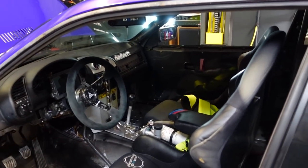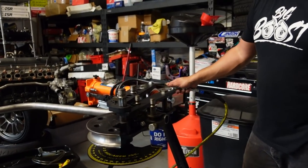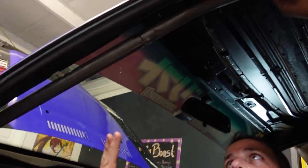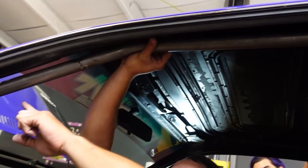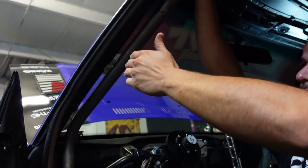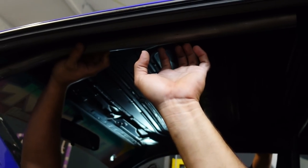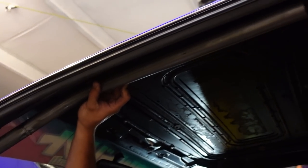Now for the next step, I'm going to have to remove the seats as well as the dashboard. I had the pipe pretty much how I wanted it — I had to cut it twice and reposition it to clock it the right way because this bend is in one plane and the other is in a different plane. I want to put gussets and have some spacing, purposely not flush in order to do the gusset size I want. Up here it's very important that it's literally touching against the roof and then into the main hoop. I bent this about two degrees too much so it's angling down ever so slightly — when I do the final piece tomorrow, I'll bend it a little bit less to get a straight shot into the main hoop.